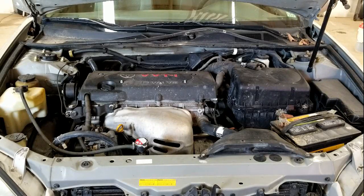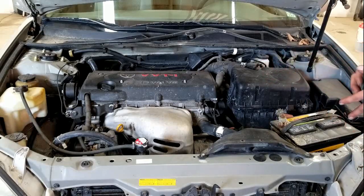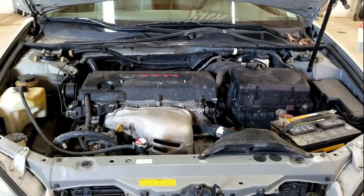The color of your transmission fluid will vary. For most older vehicles it'll be a bright red. If you have a CVT transmission, it may be clear or a different color. If the fluid is a brownish, sluggish color, more than likely it's shot and you'll want to have that looked into. Also keep in mind that some newer vehicles don't even have dipsticks anymore — you have to check the level on the display inside the car. On some vehicles, like Range Rover, you can order an engine oil dipstick referred to as a technician's tool. Some transmissions require checking from underneath at a specific temperature using a special tool.